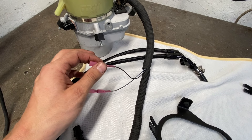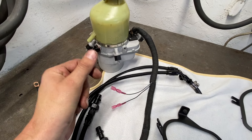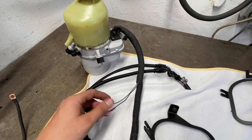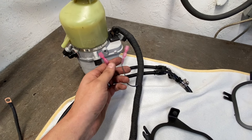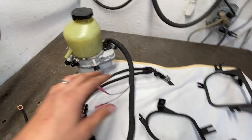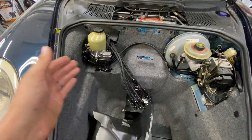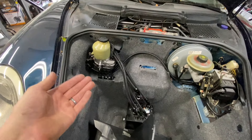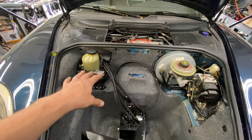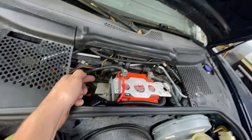There are two wires: the black wire is the 12-volt ignition wire and the blue and white wire will actually turn the pump on immediately. Alternatively, you can wire them both together so they get a 12-volt signal when you turn the key on and the pump will slowly spool up. I have mine done that way — it's a little less draw when you initially turn the car on. I have mine wired to my fuel pump signal so once the fuel pump turns on it signals the power steering pump to turn on.